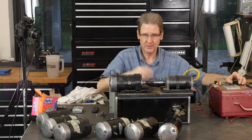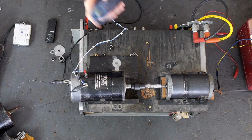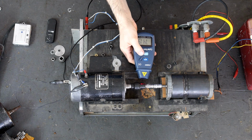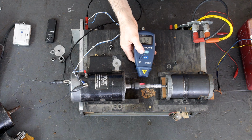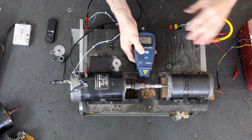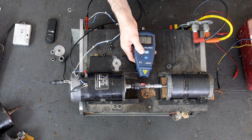Look at that, I got 5 volts already. Let's see if my little tach thing, can you read it? Yeah, you can kind of see it. It says, see, it's all over the place. That's why I can't trust this. 650, 650, 650. Then, raise it a little. Let's see. 727. So the generator runs 125% of your engine speed.